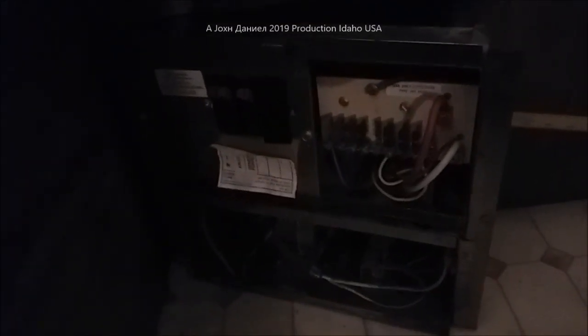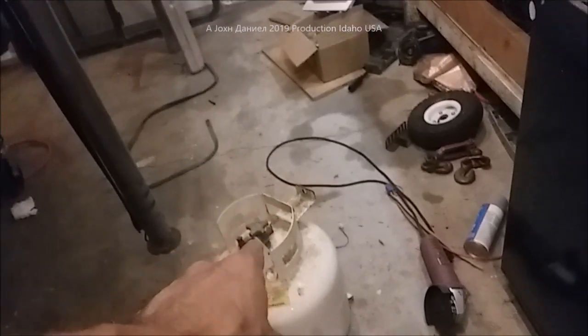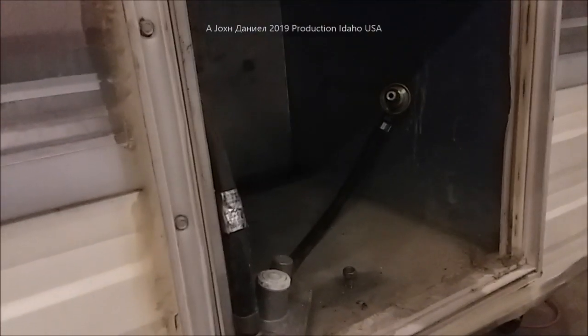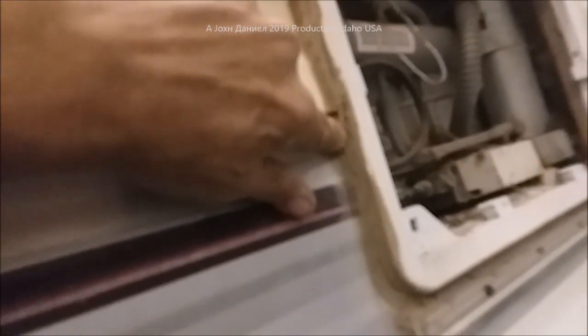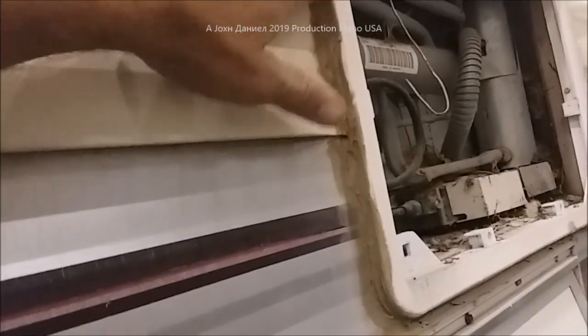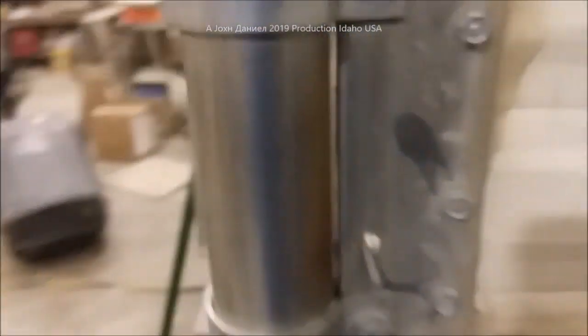The reason for using the solar controller is that these converters charge batteries at up to 16 volts and don't have a battery temperature sensor — that's a bad deal. The ladder is going to have to move out an inch to mount the air conditioner. The horizontal propane bottles are a pain — I'll do a dedicated video on how we're going to handle that. So we're going to have about four or five videos on things related to this build. The refrigerator is new but they did a really poor silicone job when they swapped the door, so we're removing that and resealing it properly. We've also converted all the lights to LEDs and got them working.